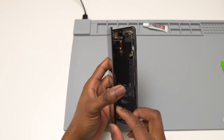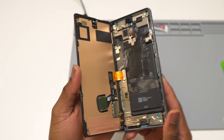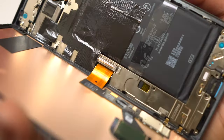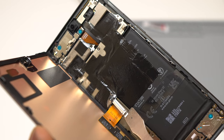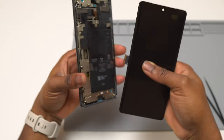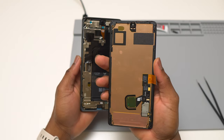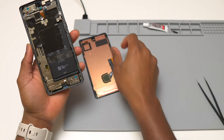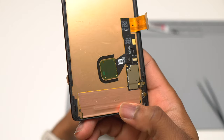The device is now completely open and you can see the flex cable of the screen. We need to remove the retaining plate on top of the flex cable — go to the side where there is a small area to pull it and remove the retaining plate. Once it's out, pull the screen firmly while holding the screen flex cable. Note: I should have turned the device off, but the screen was unresponsive so I couldn't.